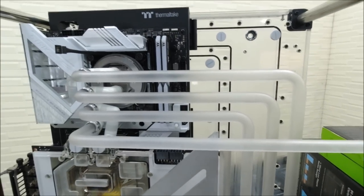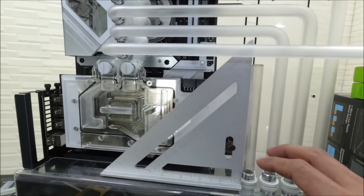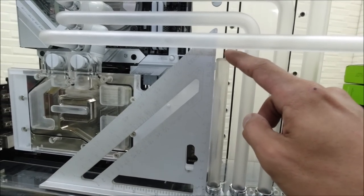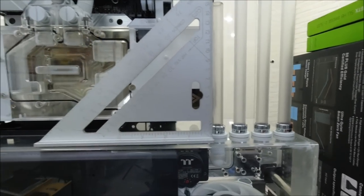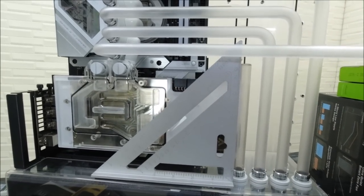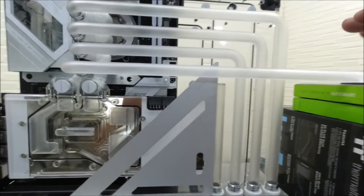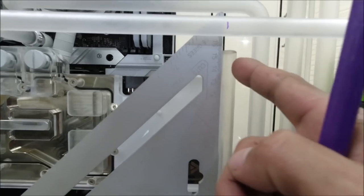Okay, what I do is I use every time the tube does a bend. So when you put in an old tube, you have to also level this one before marking it. Don't forget to level it first, okay? So like this, you would see that it's almost level. Okay, so I'll just put it like that. Now you use some leftover boxes there, and when it's squared, then that's the only time to mark. Okay, and then you mark again on the inner part.